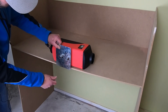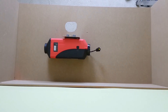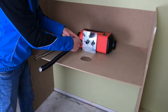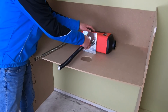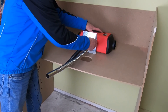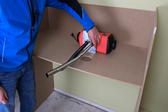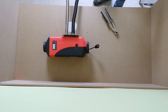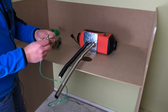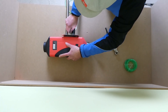Now mount the base plate to the heater with the provided bolts. We're going to need a few extra parts: clamps. This is the air inlet - the black one - mount it with the clamp that comes along with the set. And the same goes for the exhaust outlet. You might consider using better clamps than these because the Chinese ones aren't very good, so for safety precautions I would recommend buying better ones. Then take about one meter of the fuel hose, cut it, slide one of these little clamps over it - and for this one also, maybe you should buy better quality.